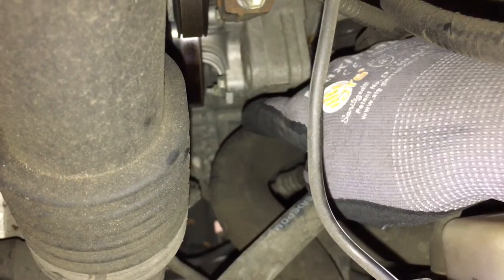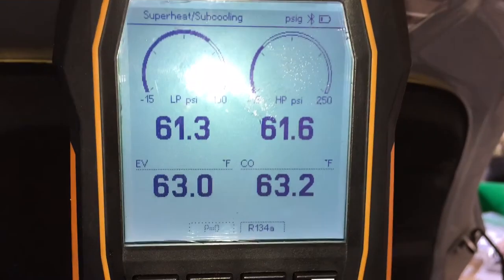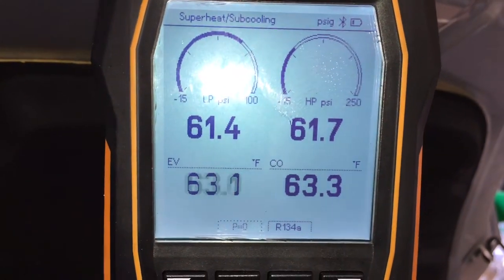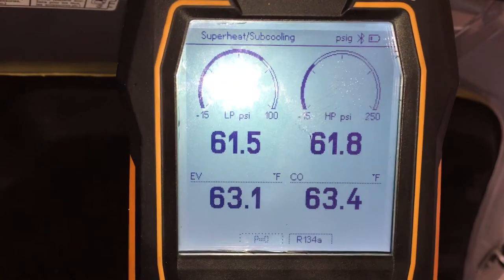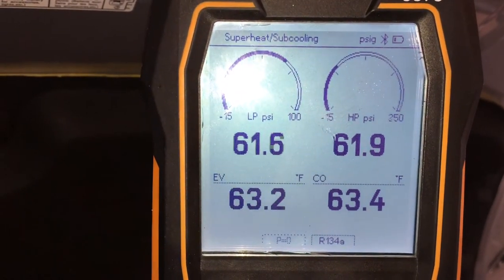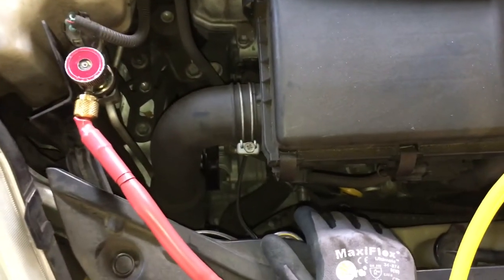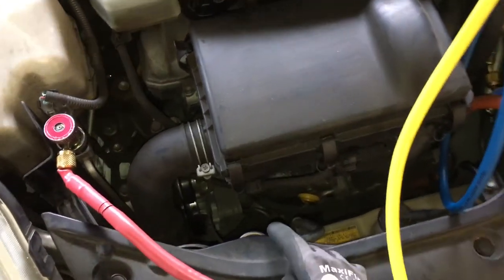You hear that noise? That was the compressor trying to come on — you could feel the vibration in the hose. Let's see if it tries one more time and we'll look at the gauges. You'll hear the fans try to kick in. I think it tries three or four times and then just shuts off. Maybe I missed it because it tried to kick in while the engine was running and we couldn't hear it, but that was the noise — I'll do it one more time to repeat and record.